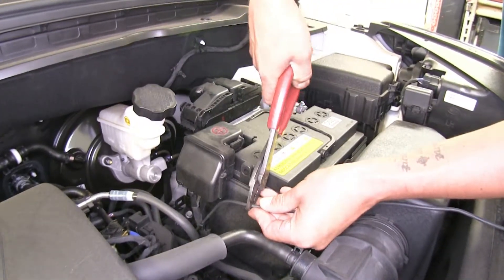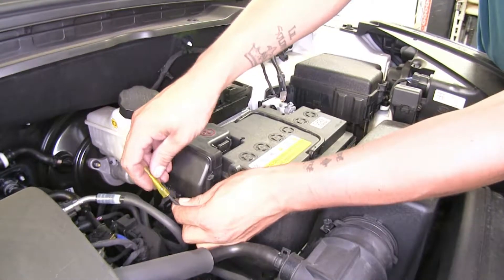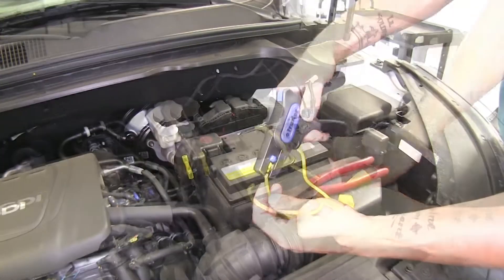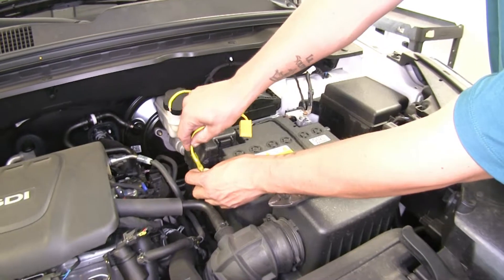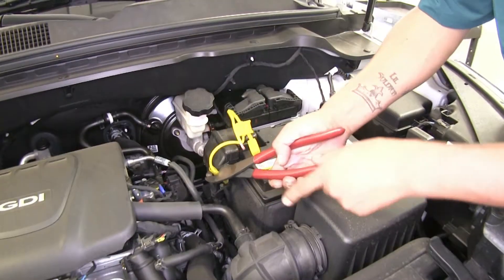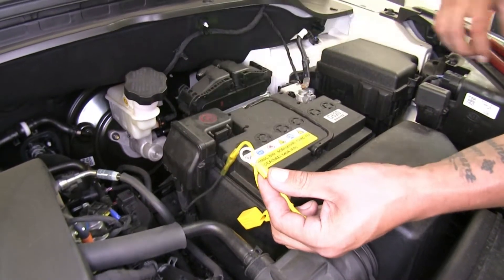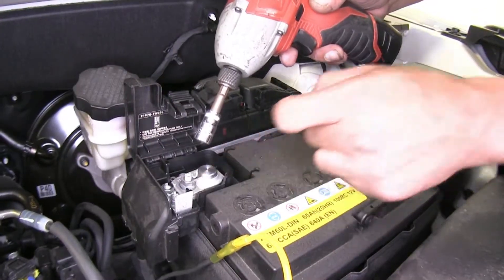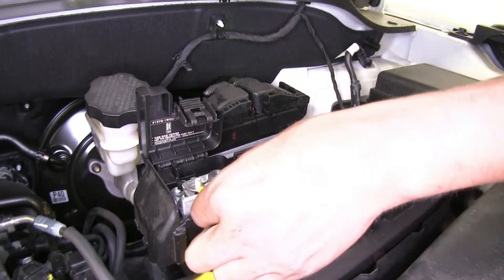I'm going to go ahead and cut my black wire and cut the excess off, then strip back the end of the wire. I'll take another butt connector and attach it to the wire. In our kit they do provide us with a fuse holder — it's one solid looped wire so we're going to cut it in half and strip back both ends. On one end of our fuse holder we're going to insert it into the yellow connector we just attached to our black wire. On the other end of our fuse holder we're going to attach the ring terminal provided in our kit, then attach the ring terminal to the positive post on our battery. I'm going to be using a 10-millimeter socket to remove the nut on our battery, slide our ring terminal over, and then reinstall the nut.